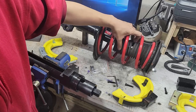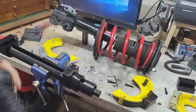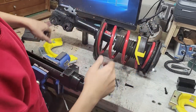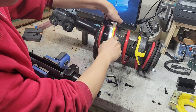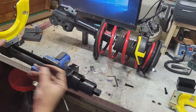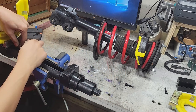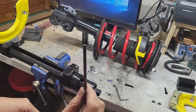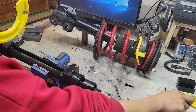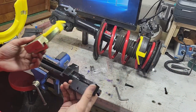You can see the boot is torn up and falling apart over here. It actually took me a bit to find the replacement part, because while it's a strut boot, it's also a spring insulator, and that's what it's listed as. Since the spring has a slight taper to it, I'm going to use this medium 110-150mm range yoke for the upper coil, and the larger 140-195mm range yoke for the lower coil. If you have a very tapered spring, you'll want to use the extension piece to help push the yoke out so that you can keep the spring parallel to the spring compressor.